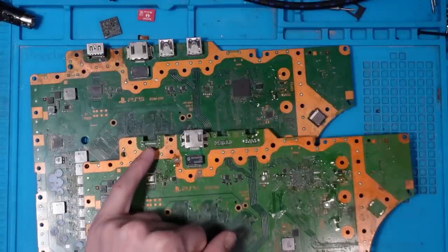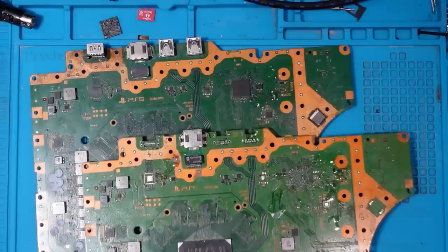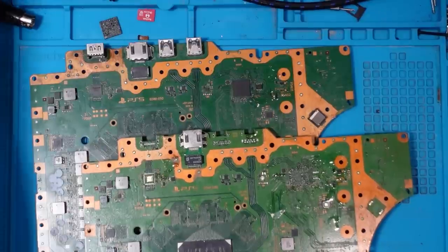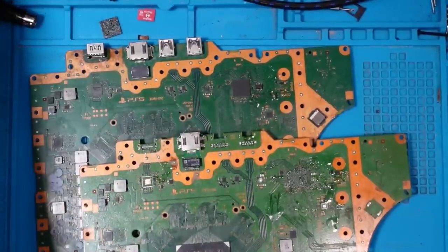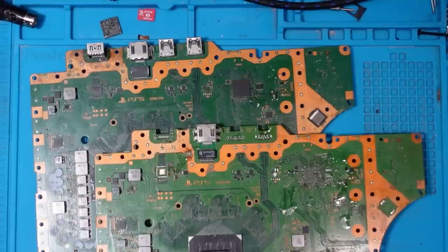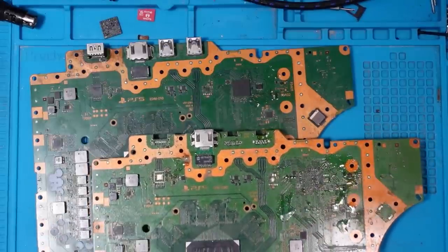The way to fix this is to have a professional or to do it yourself and replace the HDMI port. It can get quite costly depending on where you go, but if you've got a soldering iron and a hot air station then it is a job you can do fairly quickly at home. A replacement HDMI port for the PlayStation 5 can be picked up from eBay, Amazon, or AliExpress — from AliExpress around £1 which is about $1.50, and they are very easy to replace yourself.